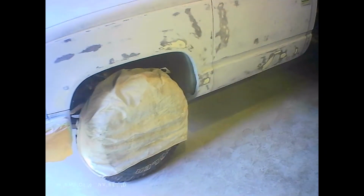Okay, and that's what she looks like after a little bit of block sanding. So you can see here and here it struck metal, so those are high spots. All these black spots are high spots, and I had a bad low spot right here, or it's just too high all the way around. When I give it another shot of primer, the next time I sand it, most of that will disappear. It'll just stay gray because it's pretty good right now.